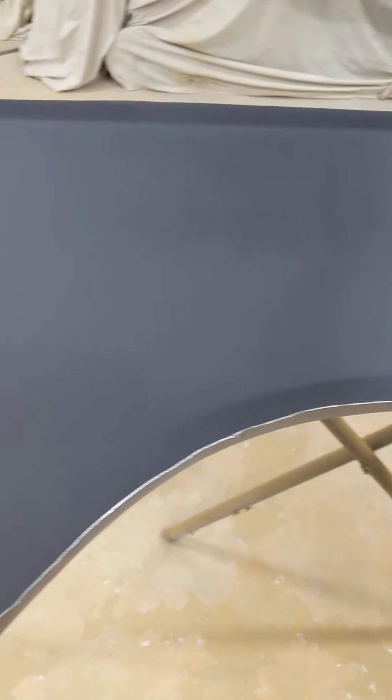They come bare metal. So you can see I got the backsides all primered up. And I got holes punched in the places where we're going to plug weld. I just got to go back and take a little Scotch-Brite and put a little bare metal by each one of the plugs there so I can weld it. But it's actually a pretty decent panel.